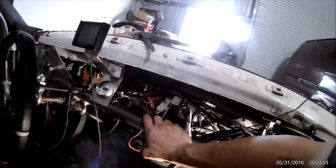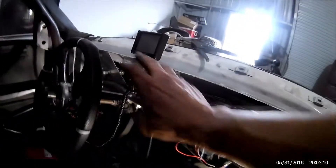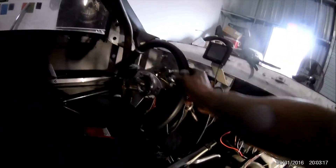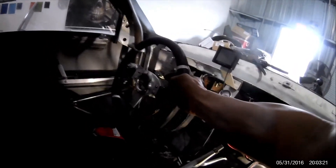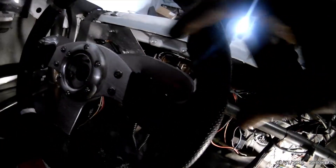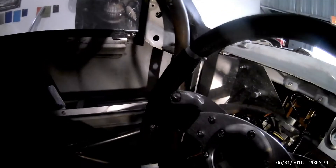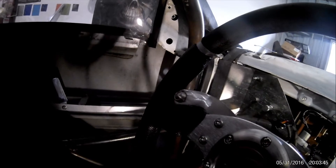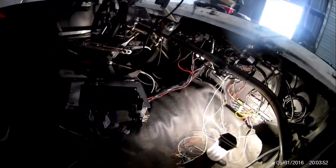I'm going to make a panel to cover that section — similar to what I did with the second wideband gauge. I'll get another piece of sheet aluminum, copy this with about a 30-degree angle bent into it, cover the whole open section, and paint it black to finish it up. I also made these little tabs to come off the steering wheel, screwed on with some nice button-head Allen screws. That side has the bump button and this side has the trans brake and two-step button. That bump button will also act as my boost scramble — which is good to have in case you're losing, just whack the button and add whatever percent boost you want.